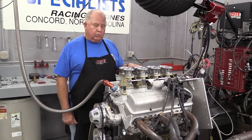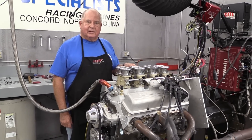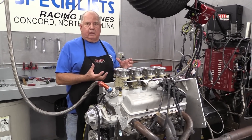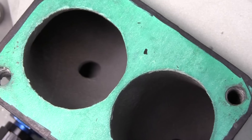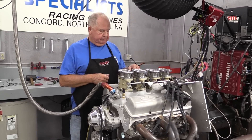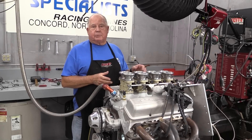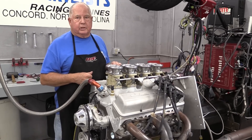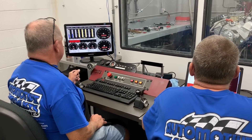The intake manifold is also pretty unique — it's a four two-barrel setup with no names on it that came from a swap meet. It was cleaned up and modified: the underside was used as a balance chamber, with holes drilled in each runner so it behaves like a common plenum, giving the MAP sensor a good reading. Interestingly, this setup made more bottom-end power with basically the same components and camshaft as the single four-barrel manifold, so it's going to be a really cool piece in the car.